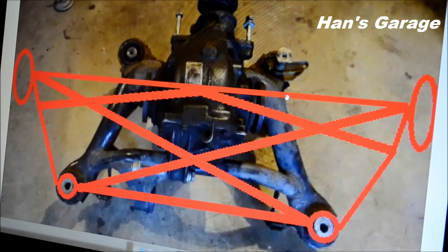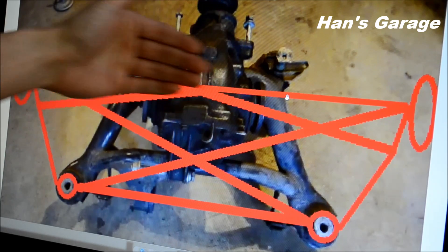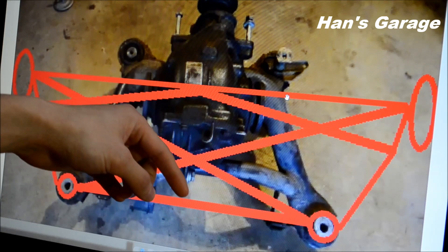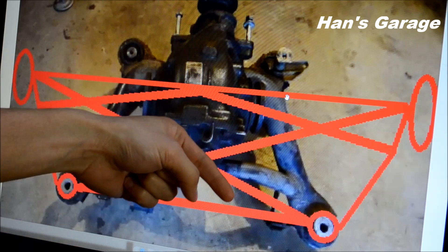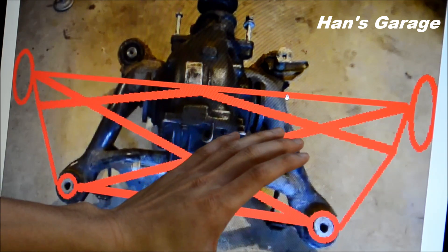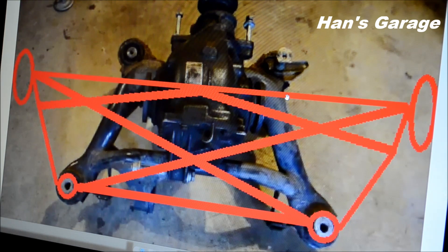This is the final step and I think it's the hardest step. You have to jack up your car and support the subframe using a floor jack to support the bottom side of the subframe. All you need to do is take off the subframe mounts, which are 18mm. Once you take those off, you're going to use a half-inch drill bit which is 12 inches long — it's about $14 at Home Depot. You have to drill underneath and through the bushing hole, through the original threaded hole, and through the chassis. You're drilling about 6 inches total, through the bottom and through the chassis.